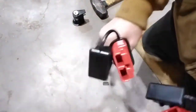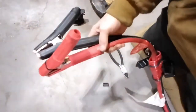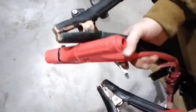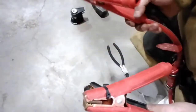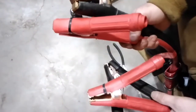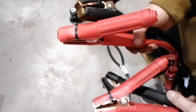What that leaves us with is a set of jumper cables that you can disconnect like this but still use as a regular set of jumper cables. So when I travel with a different vehicle or whatever I need, I have a good set of heavy-duty jumper cables. These are the cheapest zero-gauge jumper cables I could find on Amazon. The only problem I've had is the boots slide off, so up at the top of the jaw I just zip-tied them to hold the boot on — that's the only problem I've had. These things have been incredible. I've jump-started a vehicle with no battery in it — the battery sitting on the ground, just the jumper cables running over to the positive and negative wires on the vehicle — and started it. And a V8 Chevy with a 350 V8.